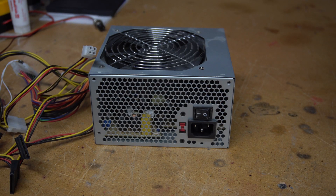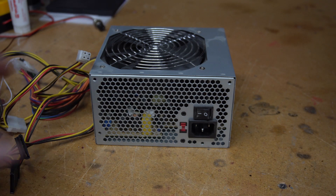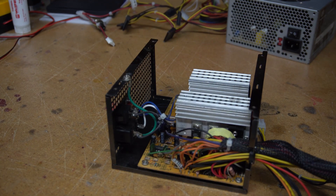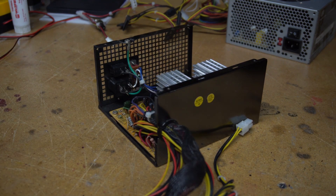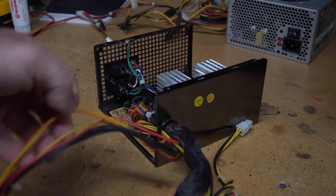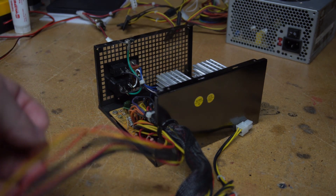For those of you who have never taken a PC apart, this is what the power supply for a regular computer looks like. If you take the cover off, it's going to look something like this. They're all a little bit different, but they basically have similar components. The ones most important to us are all these wires coming off of here. There are plenty of videos out there on how to hack a PC power supply, so I'm not going to be super detailed, but a black wire is a ground wire, a yellow wire is 12 volts, a red wire is 5 volts, and I'm not even sure what an orange wire is — you can look that up.